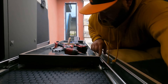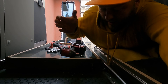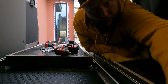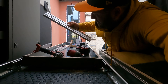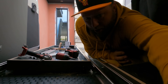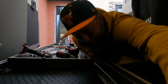On the back I've just face-mounted one exactly the same as on the front. Once it's all pulled out, all I've got to do is reach around, feel for that pin, push it down, and it's locked in the out position. To put it back in just feel around for the red button, press it, and she goes closed. So easy, so simple — I don't know why they don't come with them. Now looking at the bike mounts from MTB Vans — not sponsored, I've just ordered them from there, but they have excellent reviews and a good price for the bike mount kits.